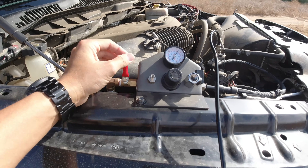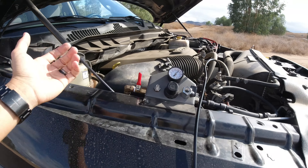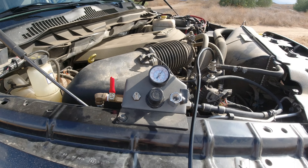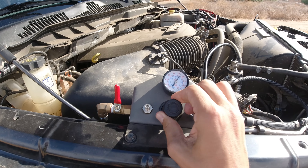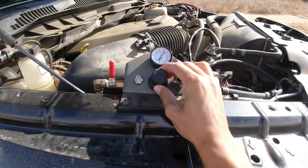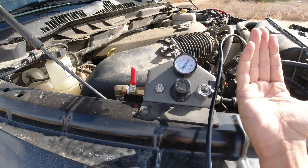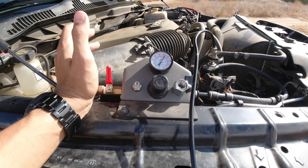Airing up your tires is really easy too. You're going to hook up all of your airlines to all of your tires and then flip on your air compressor. When that happens, it'll start plumbing air from the compressor into the controller and then that goes to the tires. You can even adjust it so it shuts off exactly when you want. There's a little adjustment here — this works just like an air compressor max output basically, so you can limit it. After you do it a couple of times, you'll figure out exactly where you need to have this set. When you turn on your air compressor, it'll fill up your tires, and as soon as it hits the pressure you want it to stop at, it'll stop.